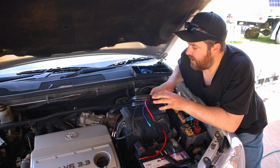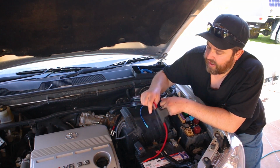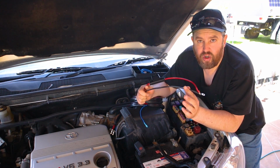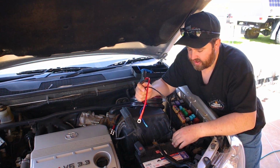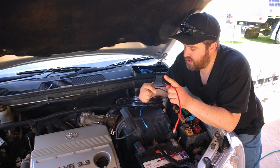You want to start the wiring under the bonnet here. Like I said, this 3-core I hadn't seen before. They've got the 8mm positive and negative. Now you want to protect this with convoluted tubing. Anything under the bonnet, protect with convoluted tubing. So you just connect this one here to the positive, and the negative just connect to your battery negative. It already has a built-in 80 amp fuse with a spare one to come as well.